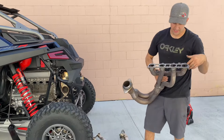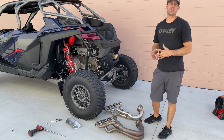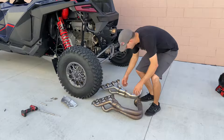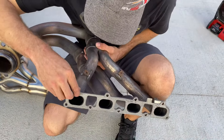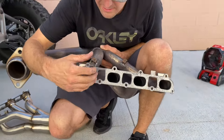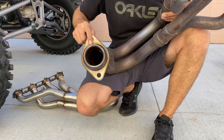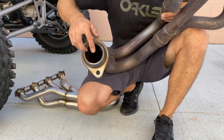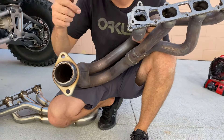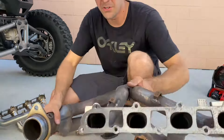This is why it's so important to replace the gasket — the material just comes off. These gaskets are not reusable. I know everyone wants to try it and risk it, but it's not worth the $40 we charge. You can see right here — even with a razor blade they come off in pieces, so don't waste your time. This machine has less than 100 miles on it. The exhaust donut — whether ours or OEM — stays stuck to the head pipe and will disintegrate just like this OEM one. Replace both gaskets.